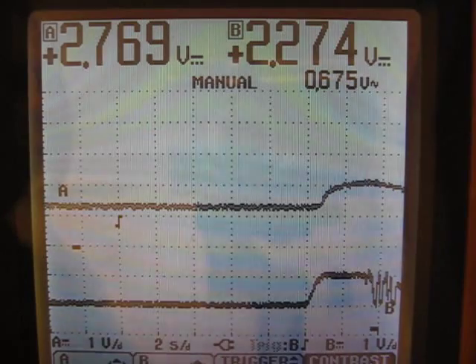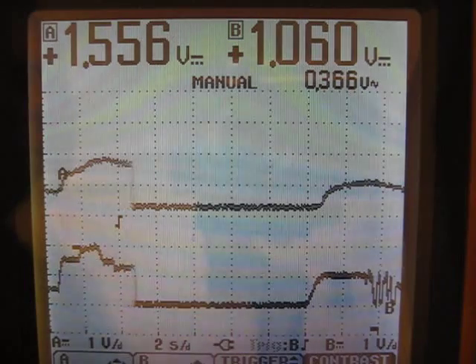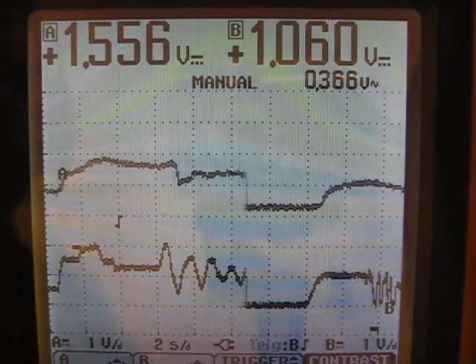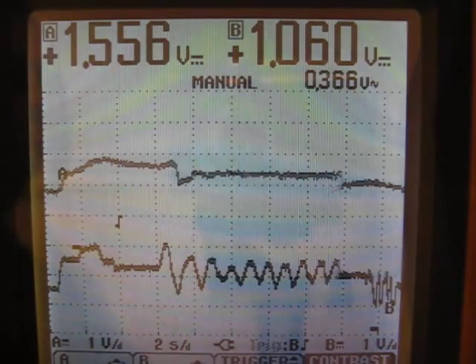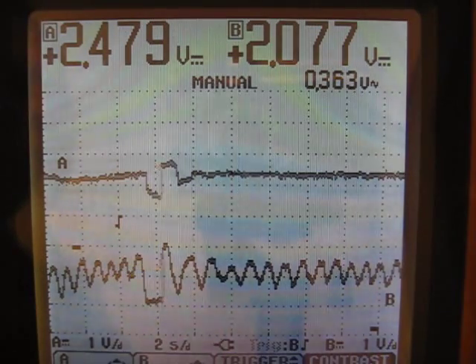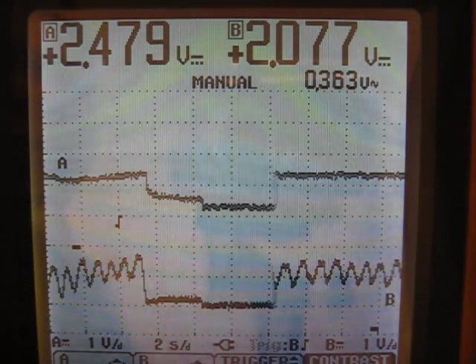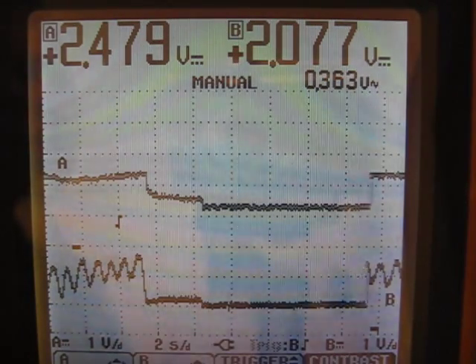So here we go — I have it now set to the maximum buffering. Let me bring it up to a range where you can see it a little bit better. Now make large, slow throttle movements. When it's dropping off there, it's dropping off because I'm allowing it to sit down too low. I have a background process running that says if it detects the throttle is going closed, it actually drops down really quick. So you can see it drops off — this prevents you from, when you let off the throttle quickly because you need to, the motor from continuing forward.